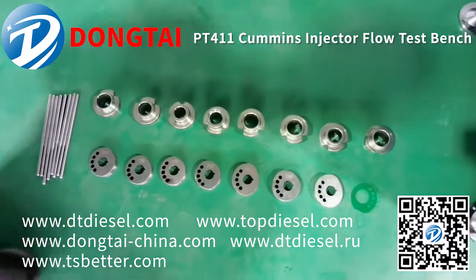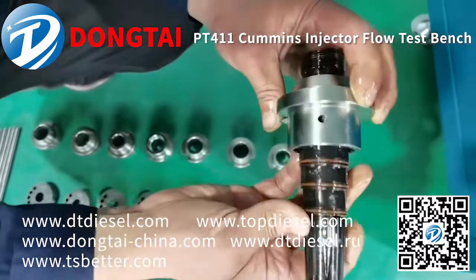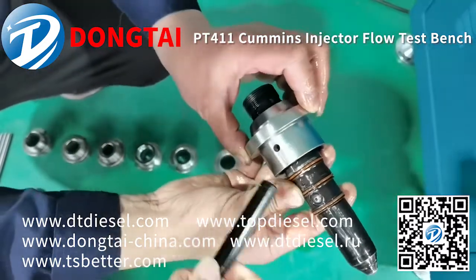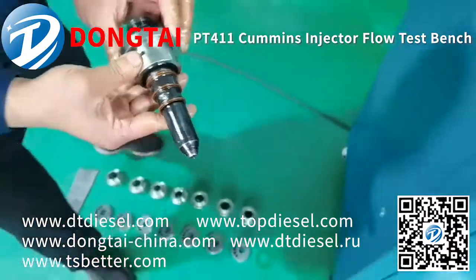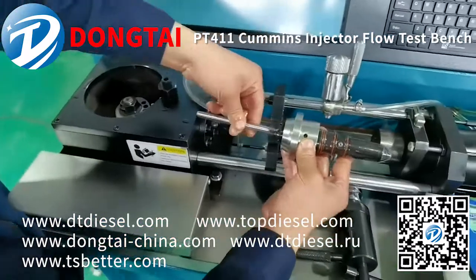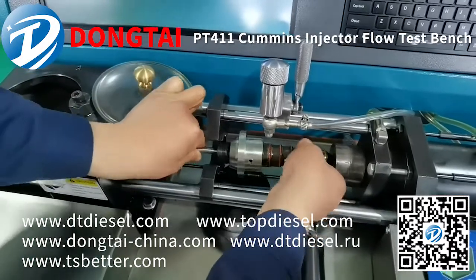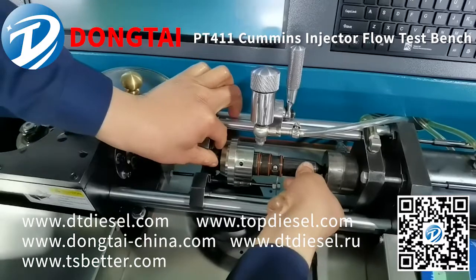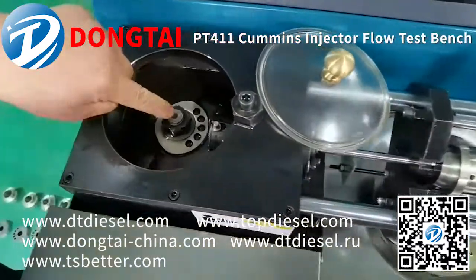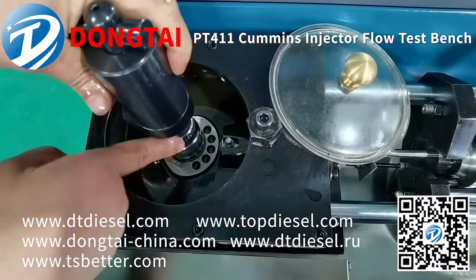Next step is to choose the correct adapter and pushing rod. Make sure the two holes are on the same line. Pushing rod. Adjust the pushing rod adapters and the injector on the cam. Make sure the cam position is at the highest point.